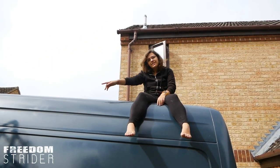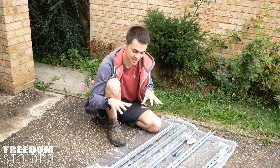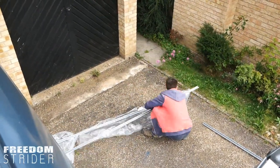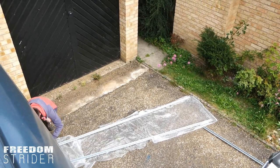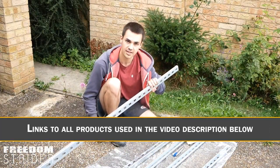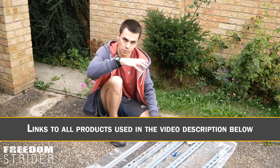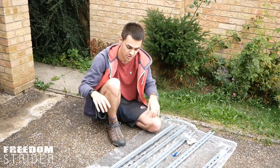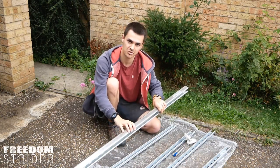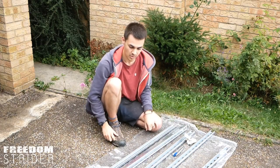This ladder terrifies me. For our roof mounting rails, we're going to be using this stuff which is unistrut. We chose unistrut because it's cheap, it's easy to work with, and it comes in lots of different sizes. The 21 by 41 will neatly nestle inside the roof channel so it sits flush, and then the larger 41 by 41 will be used for our roof rack legs and will go on top.